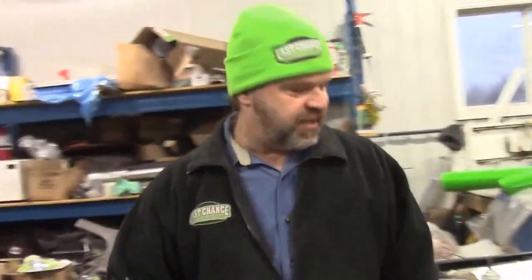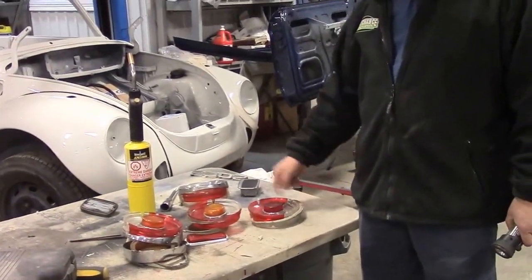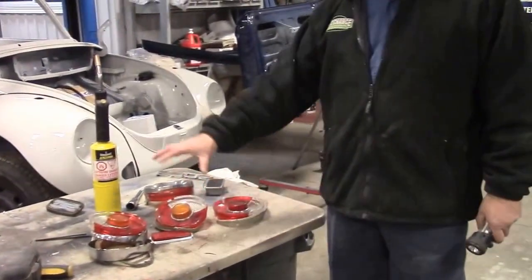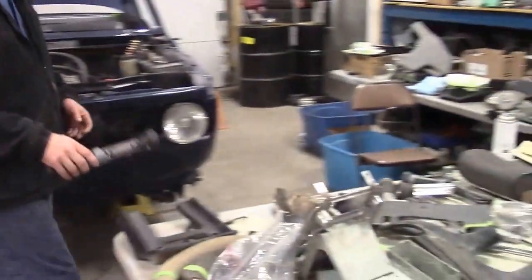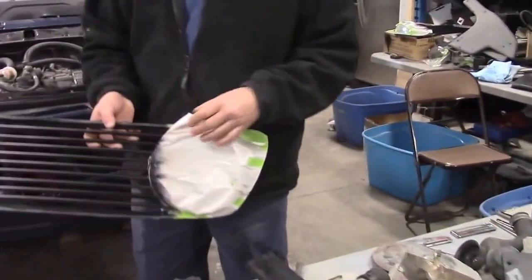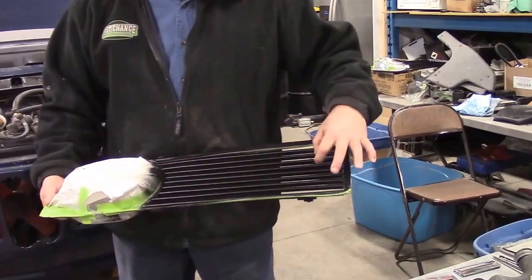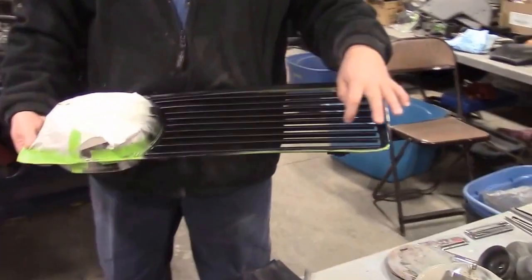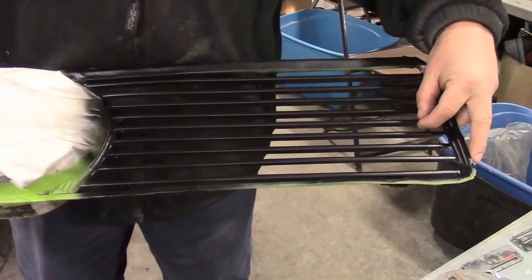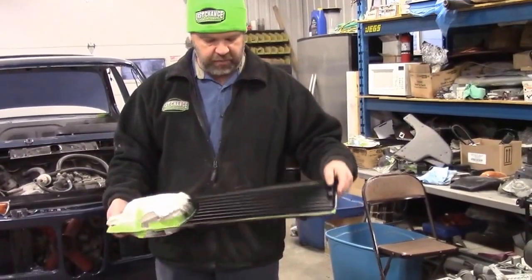We'll come back around to the front. We've got a bunch of parts scattered on the tables — we're trying to pick the best of the tail lights. Some are damaged and cracked with gaskets and hardware missing, so we're going to go through and see what the best components are that we can reuse. We've done a lot of work on the grills. These are the headlight surrounds and the grill assembly — it's aluminum. There were some strips across it, several were damaged and missing. So we removed the remaining damaged strips, sanded all the glue and adhesive off, masked everything, primed it, and painted it with satin black.